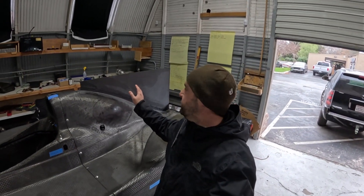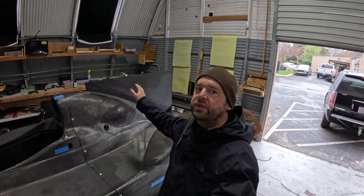Welcome back. This video is going to show you how we bonded a dorsal fin onto my Stohr WF1. Some people are probably wondering why bother putting a dorsal fin on your race car. There are two reasons: the first and obvious one is it provides lateral stability — if I get snap oversteer in the middle of something, it's going to help push the car back in line and get it upright and straight. That's helpful, not mandatory, but it's helpful. The other reason is tied to this next demonstration.